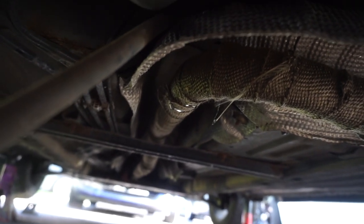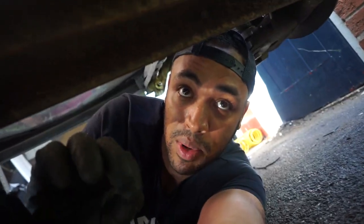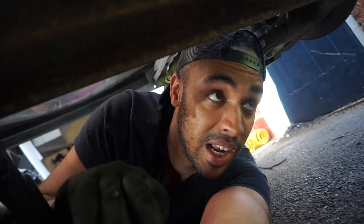The cable goes there and underneath the exhaust - how do you get underneath that exhaust to get to that clip? I've looked at the connector and it's literally just pull it out and notch it back in. My plan is to put the wheels on, put the car to the side, and then with no slack on the handbrake cable I should be able to just pull it off and put the new ones back on. This is the part I was dreading but we've come too far to go back. So from the back of the exhaust all the way back up to the middle - see this heat shield here? It's a separate part. Undo the bolts there and there, and two just there as well. Once you've got those off, that will come off and inside there is where the back left and back right attach to the rear handbrake cables. That part comes off and same on the other side, releasing the old Fiesta cables so we can insert the Focus RS ones.